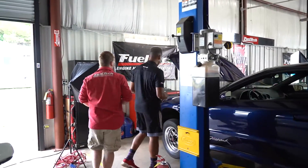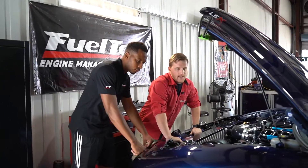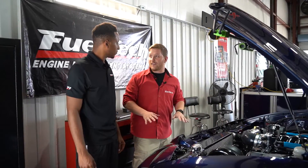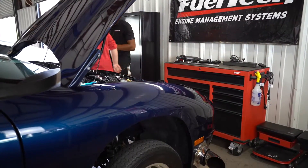Rashad, have you ever lifted a car with a hoist before? No, first time. Once we get the car off the ground, we give it a nice little shake just to make sure it's stable. That way when you're walking underneath it, you're confident that nothing bad's going to happen. We shook it, it didn't move, no scary noises, so we'll go the rest of the way up.